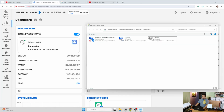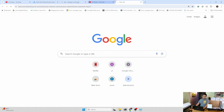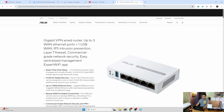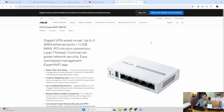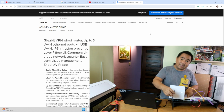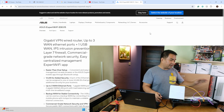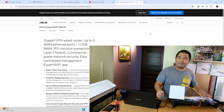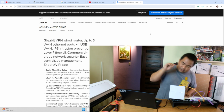So I'll try to check the internet. Maybe let's try Asus networking. Okay, as you can see, yes, we have here the Asus website. We're able to access that one. But what if we move this cable, connecting to this smart switch? It should have the same configuration of this port 8, the guest portal, or the self-defined network. So plug it in on any of that port.